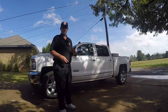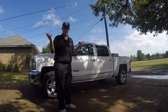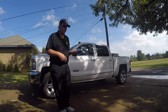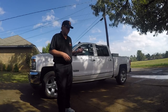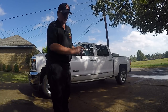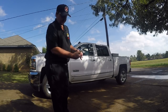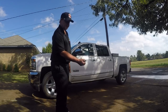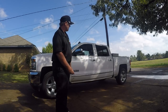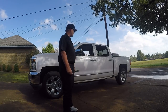The third thing you can do is roll all four windows down from your key fob. If it's a hot day and you want to roll all your windows down to cool the area before you get in, you can do that. Hit the unlock button once, then hit it a second time and hold it, and all four windows roll down.